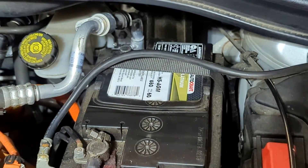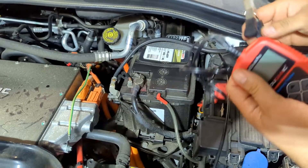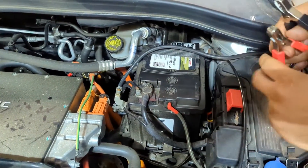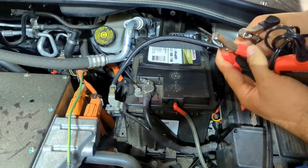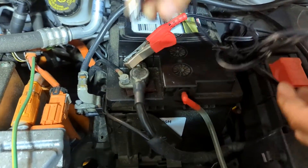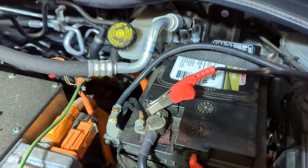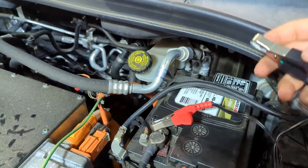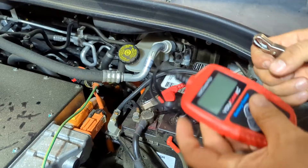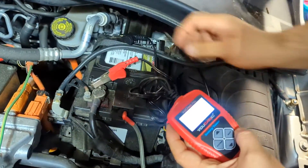The reason why I want to do this, especially on an EV — but ideally you want to do this even on a regular car if you can access the battery — is because this tool is going to measure the internal resistance and do some quick tests on the battery. When both terminals are connected, the circuits connected to it can give you inaccurate readings on the tester.